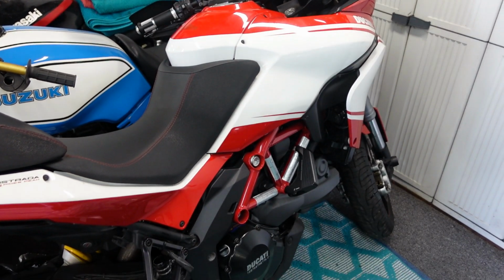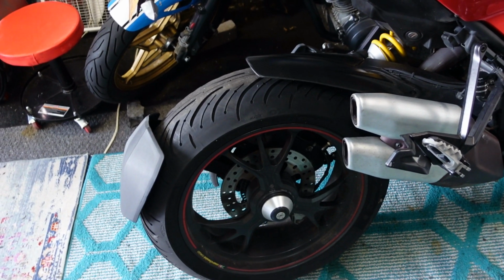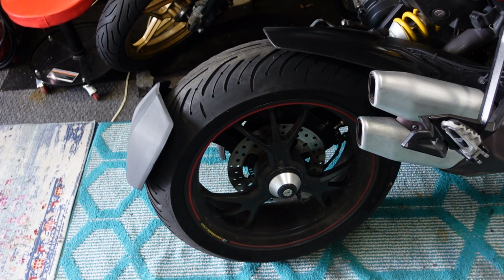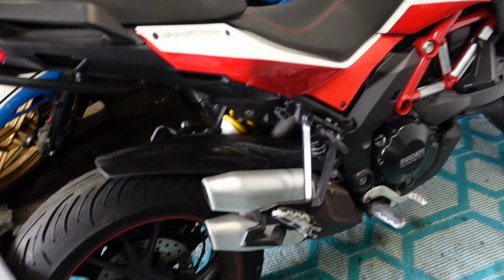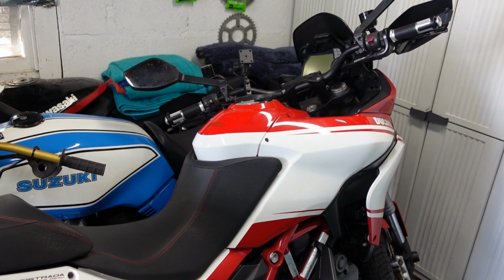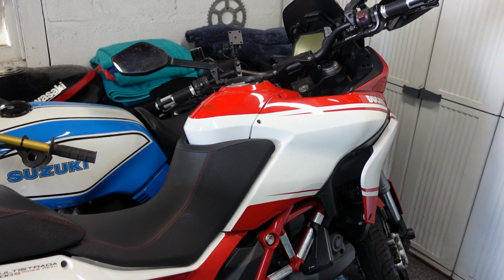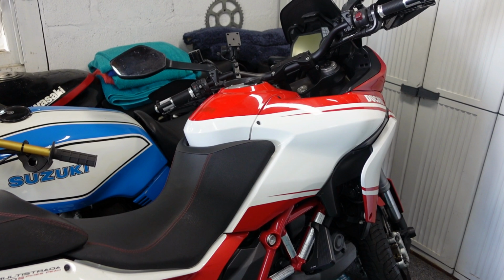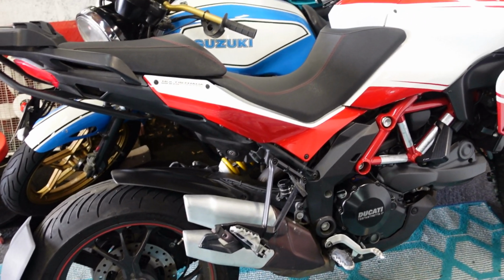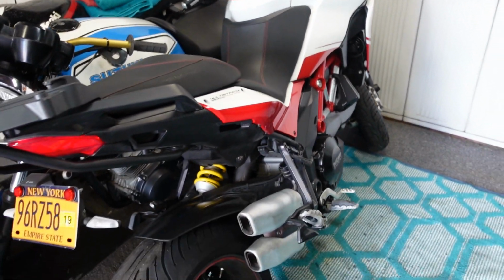Anyway, we got the front wheel resolved. The chain is well within spec. It's not out. I would get tires though, just because of the age. And we'll get fresh gas in there too. When you get it on the trailer, fill it up with brand new gas and dissolve what's in there before you run it. So we had a good time. We're well on our way to getting this back on the road and doing it methodically.